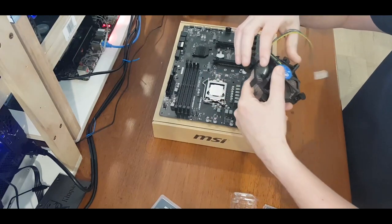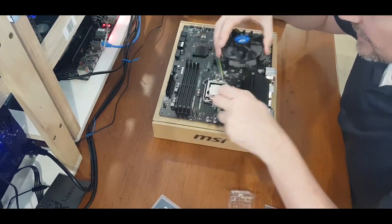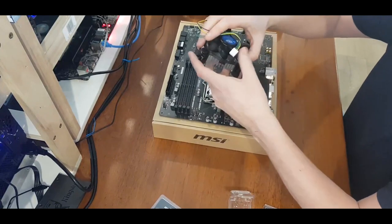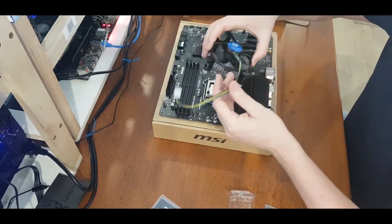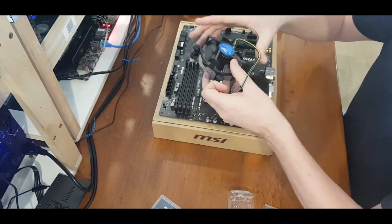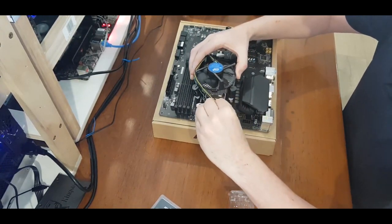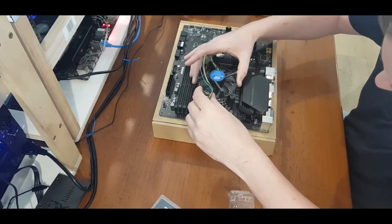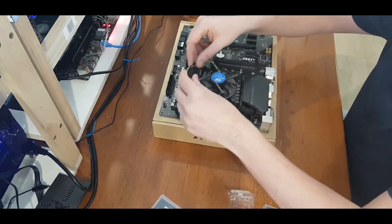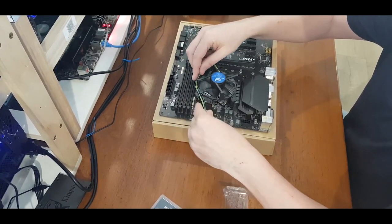I don't think it makes a massive amount of difference, but I was just checking another rig to see which way around I had the fan, and which way around the wire goes. Now, the CPU fan is here. See, there's pump and CPU there. So down here, there's pump and CPU. I was just checking which way around the wires would go. It's more just, I think, for cable management. On another rig I've got it here and coming round like that, so I reckon we'll do that again, stick with what we know. If anyone has a more preferred way for this specific heatsink, let us know. That'll go in there, and then it will go around.